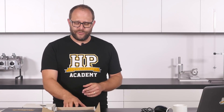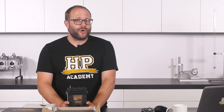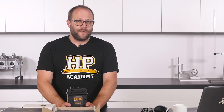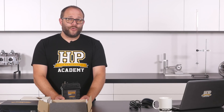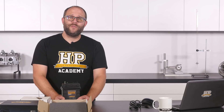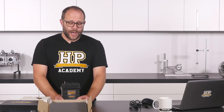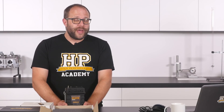Now we can talk about the unit in a little bit more detail in terms of its input and output capabilities. It's got eight injector and eight ignition drivers. The injector drivers are particularly cool because they're all programmable for the amount of current they'll output, meaning you can drive saturated high impedance injectors or any type of low impedance injector. There are also 11 user definable outputs, two of which can be used to run drive-by-wire throttle — really important for an ECU aimed at modern cars. Four of the outputs can also be used to drive stepper motors, covering all your options for idle control motors, and five general purpose outputs can run things like boost control solenoids, a shift light, or the vehicle's tachometer.